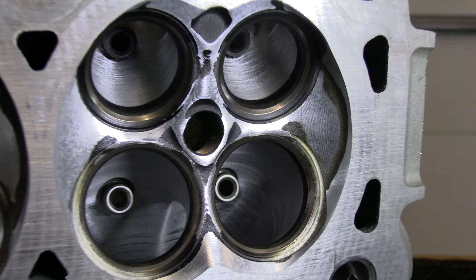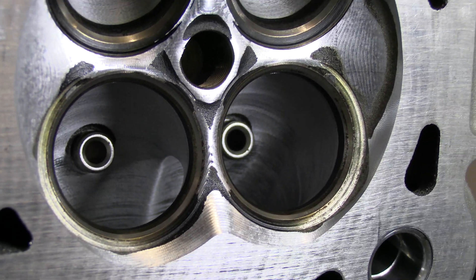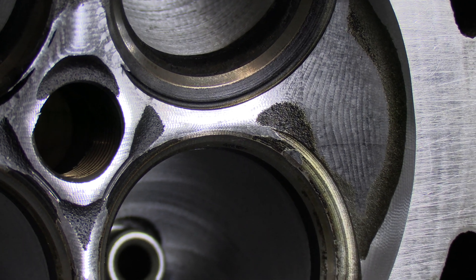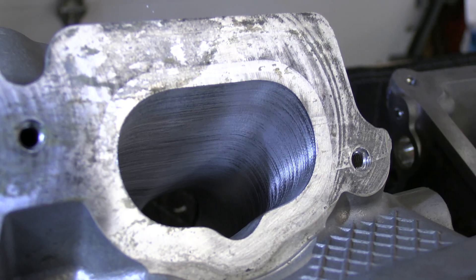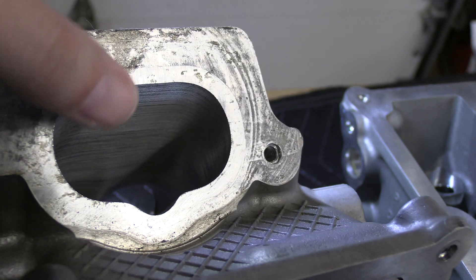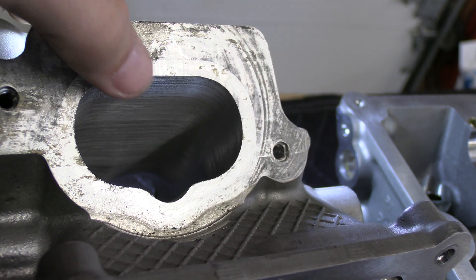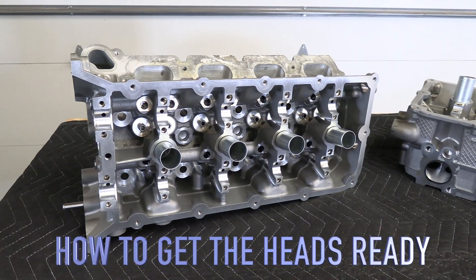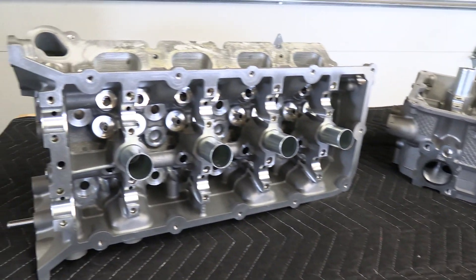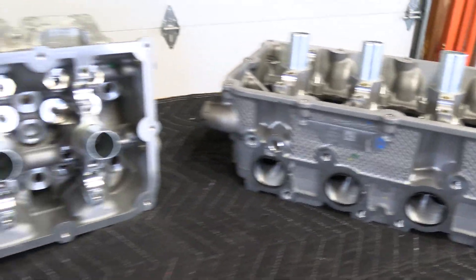Here's the exhaust port — looks really good. Here is the combustion chamber side, and as you can see there are a few areas that the CNC machine didn't get. You get what you pay for and you need to go in and finish this. Either go in with a Dremel and very lightly take off that material. Also, on the intake and exhaust ports there's a little bit of a burr around the edges, so you want to get a deburring tool and clean up those sharp edges. If you wanted to, you could bolt these on and they'd be ready to go.